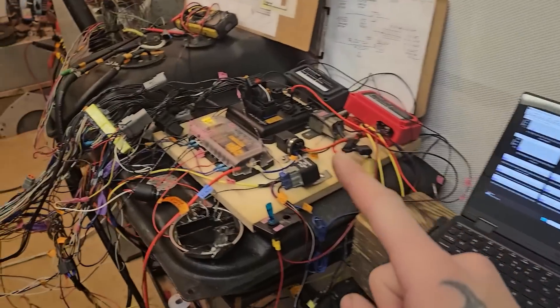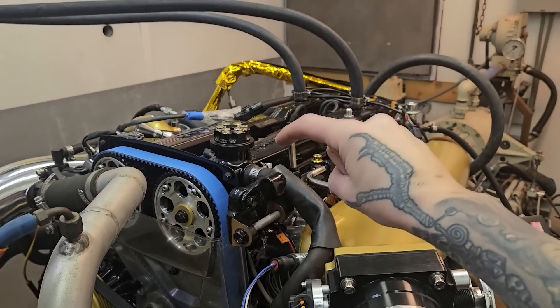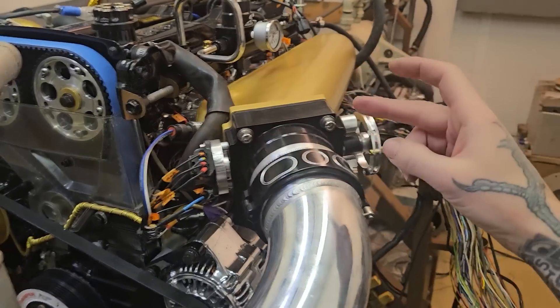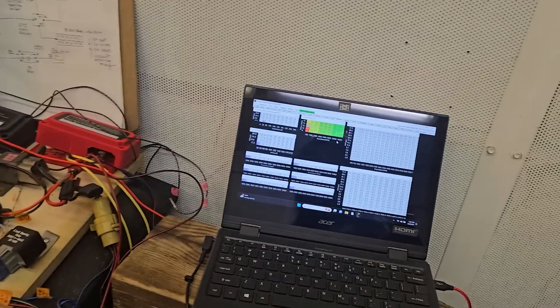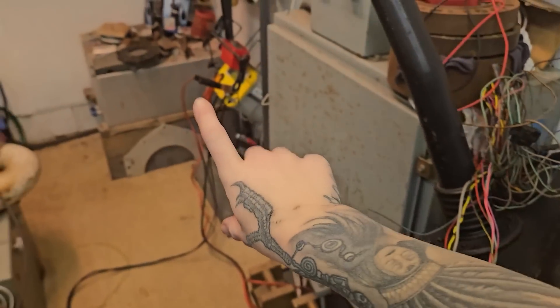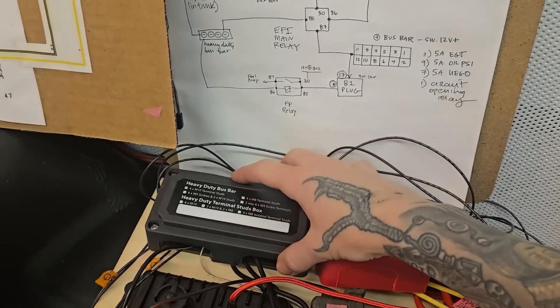I just fired up the Infinity and verified — I had all of my sensors unplugged, and I still have my oxygen sensors unplugged. I'm going to be running two different ones — one for a gauge and then one that actually talks to the Infinity — because I don't want to plug them in right now and have them heat up and just burn up sitting in their little protective sleeves. I went through and checked every single sensor, verified it was reading in range, all my wiring was correct, and I was getting my five-volt references. I've got my negative bank here, my positive bank here — little distribution blocks — and then I have my battery on a trickle charger, and I'm just using jumper cables with the ends cut off attached to my little blocks.